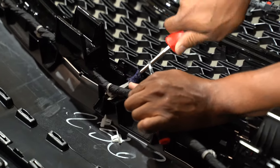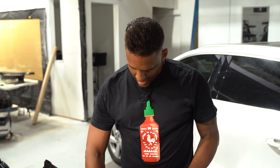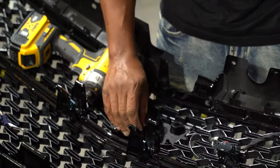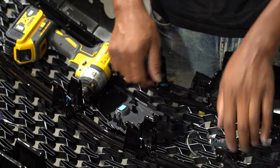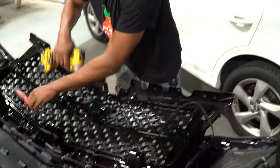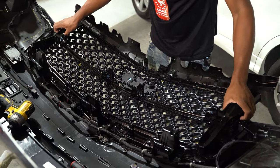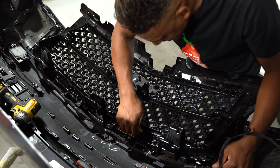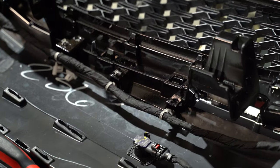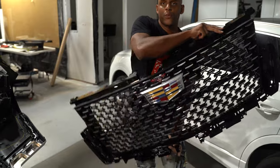My recommendation is to finger-tighten the camera screws back in place so you don't lose them. Remove the wire, get all your tools off the grille. We've got a few more clips here — use the clip tool to disconnect them. One, two, three, four — there you have it, the grille has been removed.